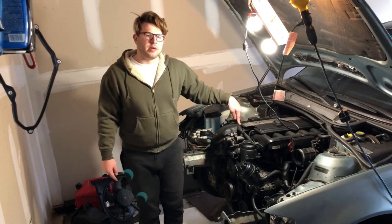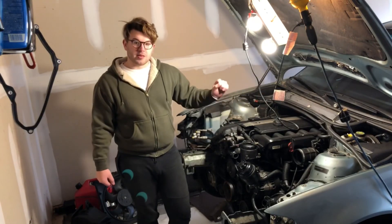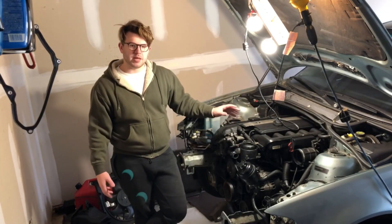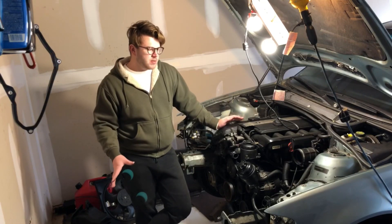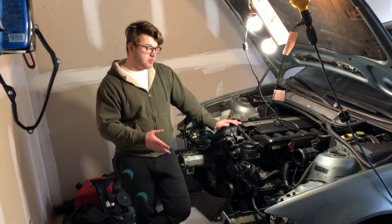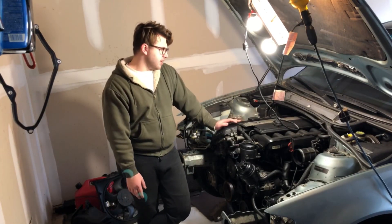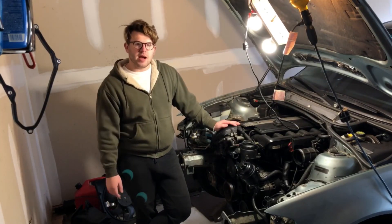So there's a drive shaft that comes up the driver's side of the motor, it goes into a small transfer case, and then the CV shafts that apply power to each wheel split off of that and go through the oil pan to each wheel. So that means if I'm removing the engine, I have to remove the shafts going to the wheels, the transfer case, and the drive shaft going to the transfer case. A lot more work than I was anticipating, but that's less rolling resistance, the front wheels will now spin freely, all the power goes directly to the back wheels, and there'll be less weight. People on the BMW forums have said removing that stuff could cause potential suspension structural integrity issues, but I don't believe that because the 325i — the non-all-wheel drive version — is almost exactly the same in terms of the suspension, and this isn't going to be a rally car.